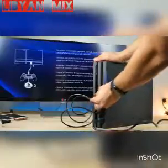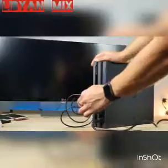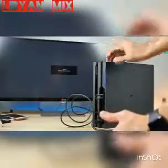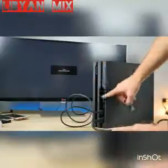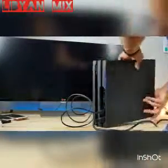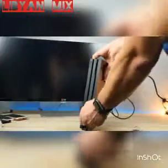Okay, here we go. Plugging the USB killer into the brand new PS4 Pro in 3, 2, 1. Oh, okay, that one did it. So it just powered down, the fans stopped. Didn't make much of a sound, but for some reason the rear port isn't protected like the front ports. So that's a very interesting thing to notice. Does it cycle and power on? Nope. This thing is dead.